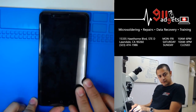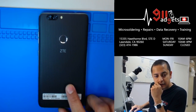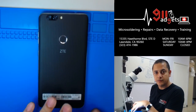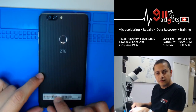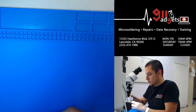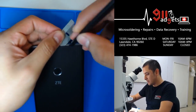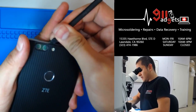All right, there it is. So for these, we have two options. We can replace it by desoldering the old one and soldering back a new one, or we can do the whole flex thing. That's a little bit easier, but we're gonna do the soldering version of this repair. So I'm just gonna get a blade here so I can wedge it, and I'm gonna stick my plastic tool and just go all around the edges.